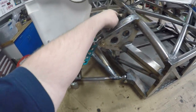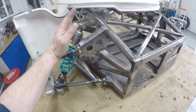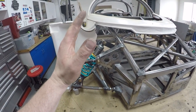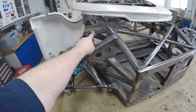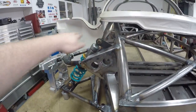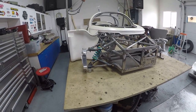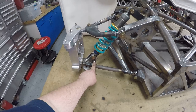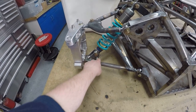The front suspension is in full droop at the moment because I'm just checking shock lengths - these are just tacked on and I'm mucking around with plates at the top. I started to put the shock at a more vertical angle to get it closer in, because the more vertical the shock absorber is, the longer the travel for the same suspension movement. Unfortunately I realized the shock was hitting the body because of the curvature there, so I threw the front clip on and confirmed it. I've brought the mount as far out as I dare.